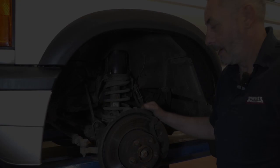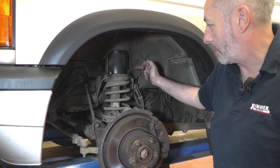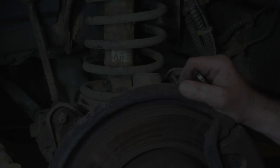We can see the shock absorber there sitting in the middle of the spring. There are two 13mm spanner-sized bolts at the bottom of the shock absorber and four nuts around the top turret. Once you've taken the bottom ones off and the top nuts off, we'll go underneath the bonnet and lift the whole shock absorber up with the turret out through the inner wing.